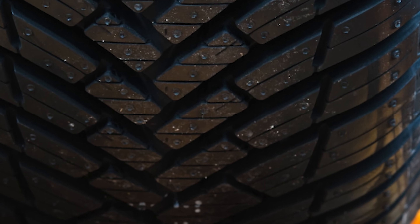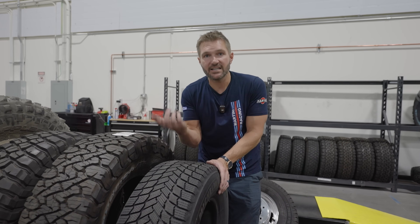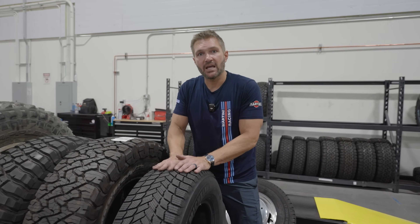This tire is so soft that as I run my finger along the sipes, it's actually flexing and gripping my finger — pretty cool. It's kind of like running your finger backwards across a fish: in one direction the scales are smooth, but in the other direction they bite your hand. That's why a rain tire is so effective. The whole design channels water from the center of the tire outward through first small sipes that feed into larger canals or channels, getting the water off the side of the tire and allowing for better grip.